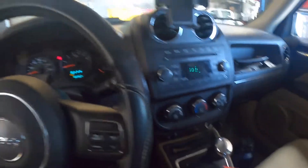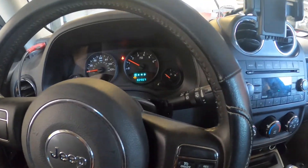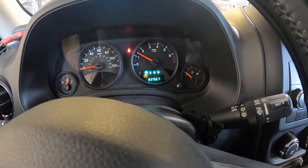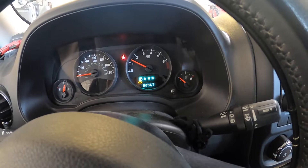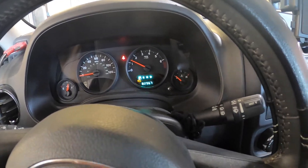I'm going to go to the throttle body. I'm not just going to replace it — the first thing I'm going to do is see if I can control that throttle body through this computer. So we'll start it up and let me look at the RPMs. We're sitting at 1,500. It should come down on its own without even touching the gas. That's already too high — it should drop down to somewhere between 500 and 800 RPMs, and it's not coming down fast enough.